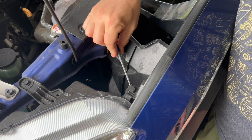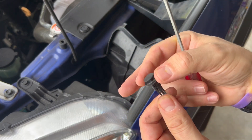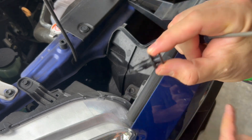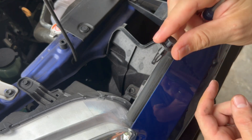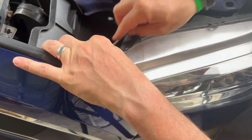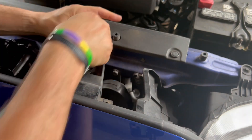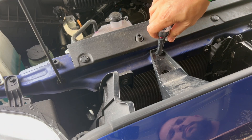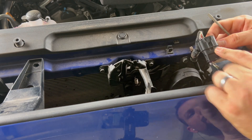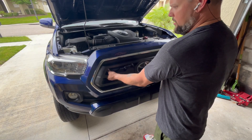Use a flathead screwdriver to pop in here and lift up. Hold on to it with your hand and pull out. You'll see this little plunger tab that goes up and down. Make sure it stays loose, and when going back into the hole, hold it, push it in, then push the tab down so it locks — that way you don't break these thin plastic keys. For the other push pin, do a little spinning motion and it lifts right up. Next, remove the two 10mm bolts and the clip by pushing down and giving it a gentle yank.